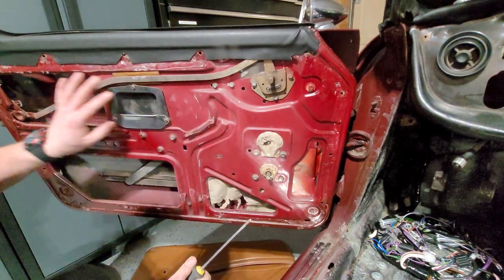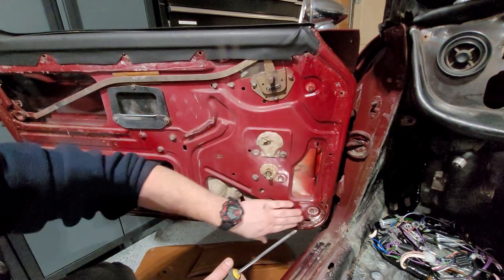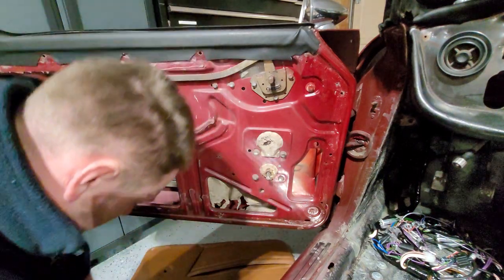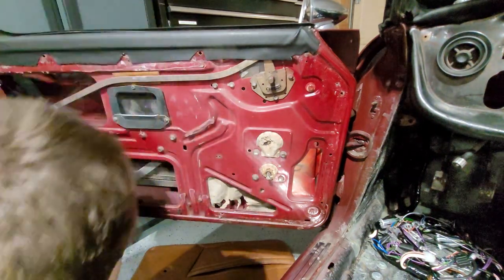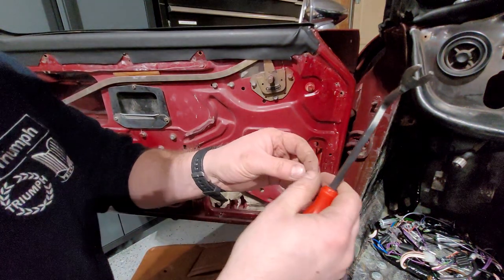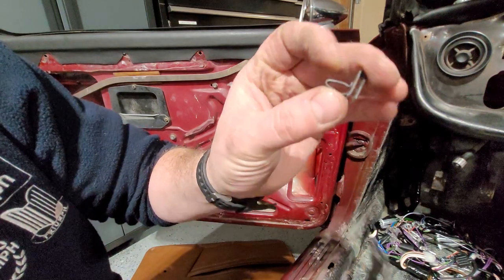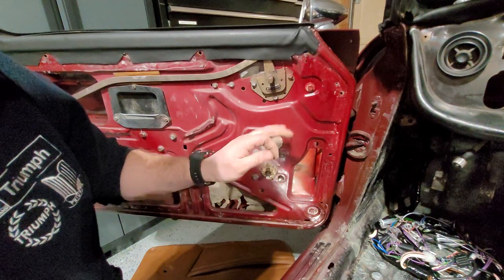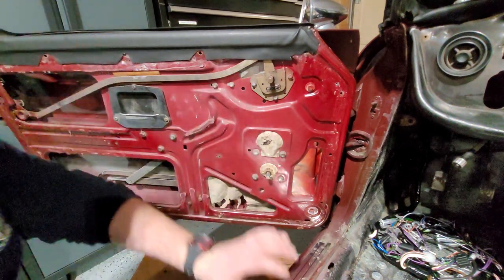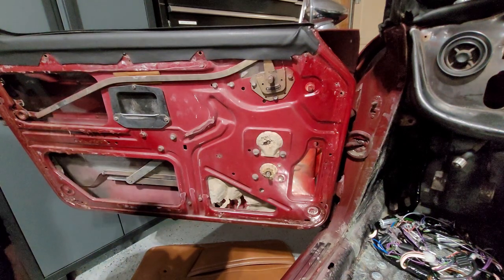The springs actually go on the inside and not the outside. Another thing probably missing off this is vapor barrier. I like to put vapor barrier on the exterior as well to make sure it's all covered up to stop moisture from coming in through the doors. The clips — one part sits in the door card and then just pops into the door. I usually start from the top and work to the bottom. Hopefully this will help you take the door card off and the handle off if need be. Any comments, questions, or concerns, contact me and I'll try to help you out.